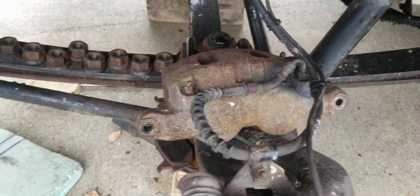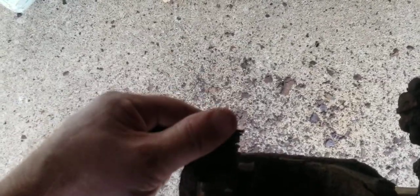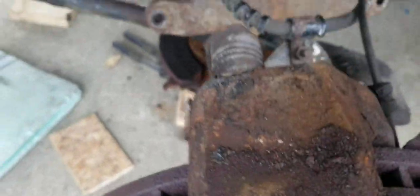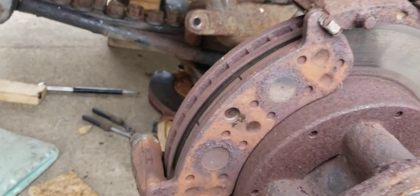Here's the caliper — it just has two bolts right here that go right here when the caliper is on. These are the slide pins and you want to pull these out. There's a rubber boot — you want to make sure that's nice and greased. If these things don't slide, the caliper will stay hung up and then you'll wipe out the inside of the brake pads.